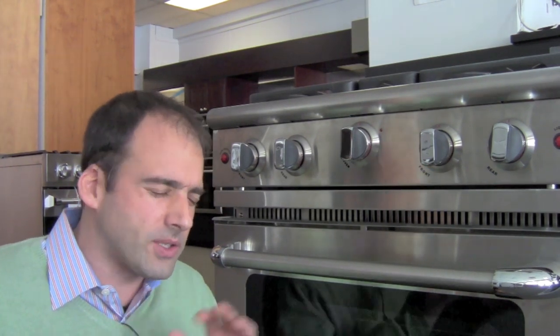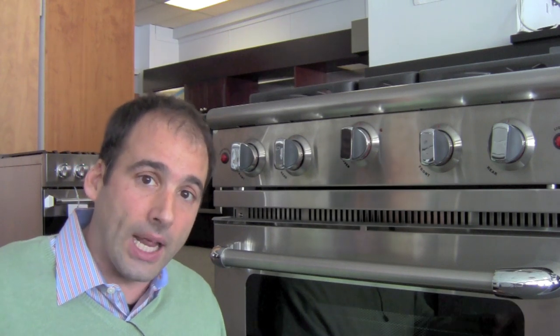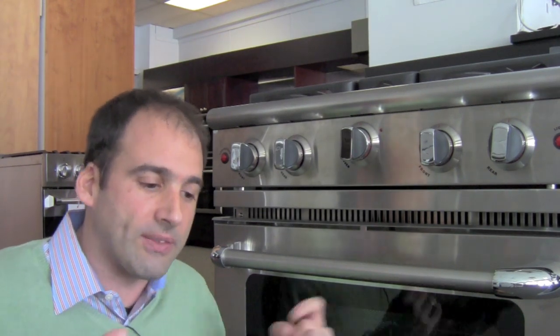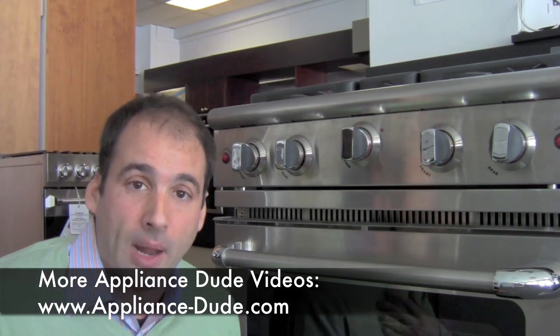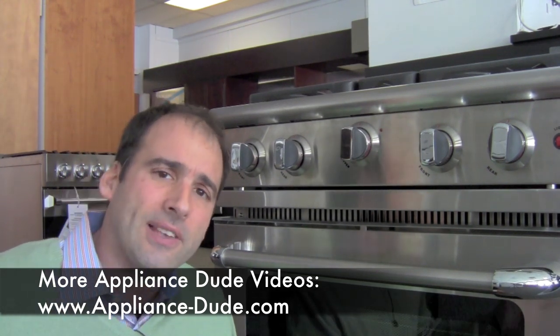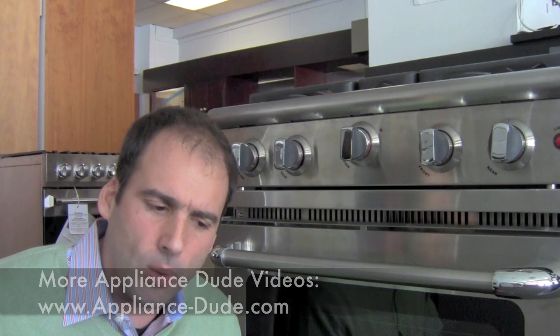For my customers in Manhattan, where I've been selling these, let's put the self-clean/manual-clean discussion aside and talk configuration. If you go with the fifth burner — the wok — I wouldn't feel comfortable in a Manhattan apartment venting with a microwave that's recirculating air back into a small galley kitchen while rocking 25,000 BTUs. It's just going to get hot. I wouldn't recommend it. I'm quite happy with the four-burner version — 18,000 to 19,000 BTUs up top. I would pair it with either the Viking VMOR microwave, the DCS microwave, or the GE Monogram. Those are the three OTR microwaves I think can handle a 30-inch pro range.